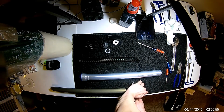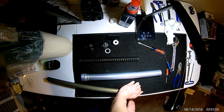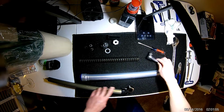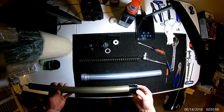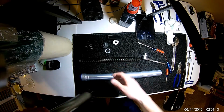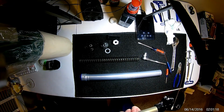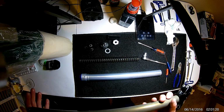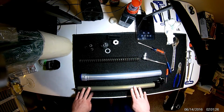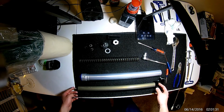There's a torque rating on this. I do have torque wrenches, although I'm not using it in this application. You should. I encourage you to. Although I feel I have a pretty good sense of how tight things have to be, so I typically don't worry about it. You can also torque these when you're done in the process too. But do follow the torque rating spec. I have added a link to the PDF file from Marzocchi on the service of this fork in the description, so check that out, and I do believe that they have all the torque specs in that document.